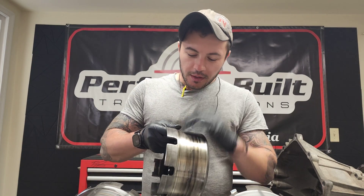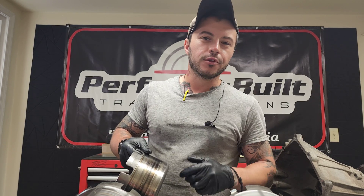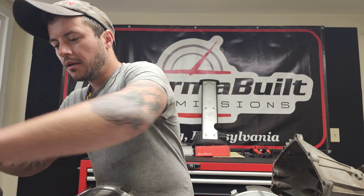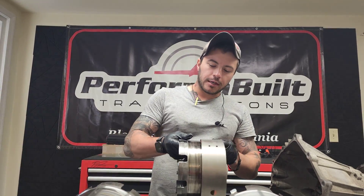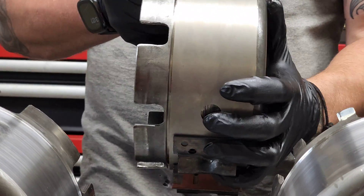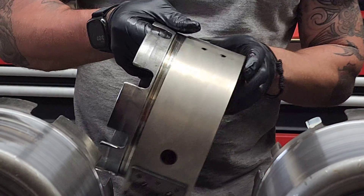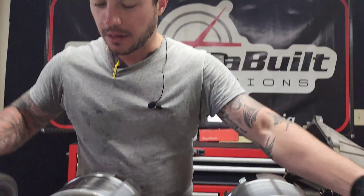Especially you guys that start slipping and just run the whole 4L60 into the ground and completely grenade it. It's not flat, especially under those scenarios, or if you've got like 200,000 miles or something. When you couple that to the wide band like we use and put it on this drum — not really thinking — well, it's not grabbing the middle because that's sunk in. There's only so much flex these components have.